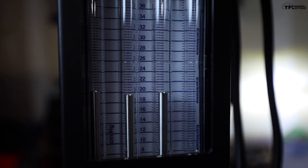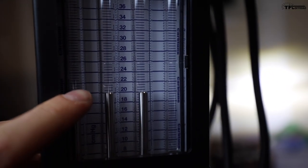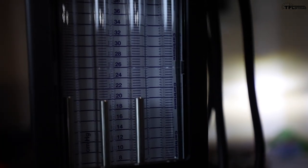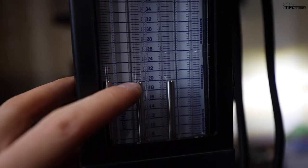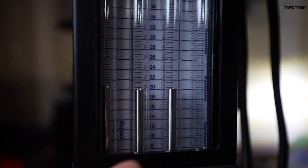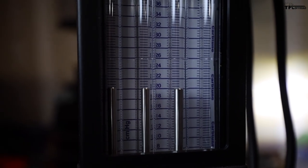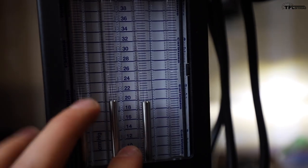As I let it settle — you're never going to get it perfect, but you never want it to be more than a full bar apart from each other on the gauge. If you're a hair away on any one of them it's not going to be a huge deal, especially once you're rolling. That looks much better than it was before. I'll check it one more time without the camera in front of my eyes — yeah, that's looking pretty good to me. I can shut the bike off now and the rods will drop back down.